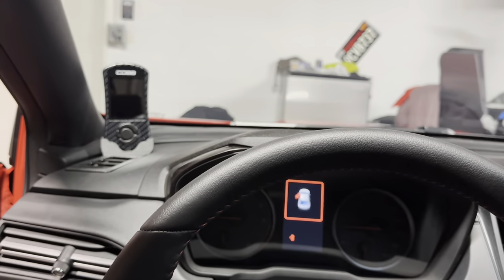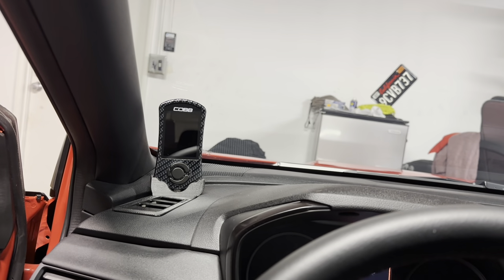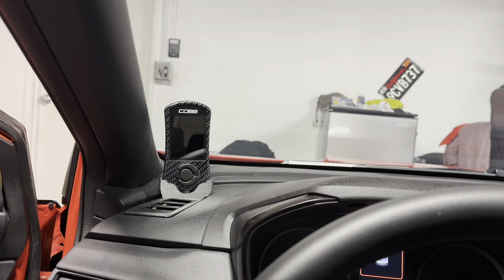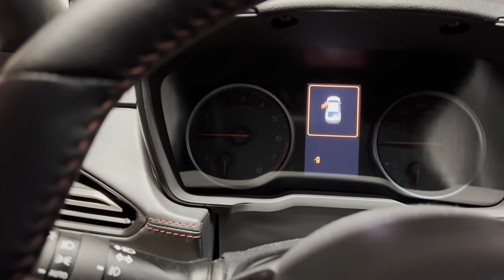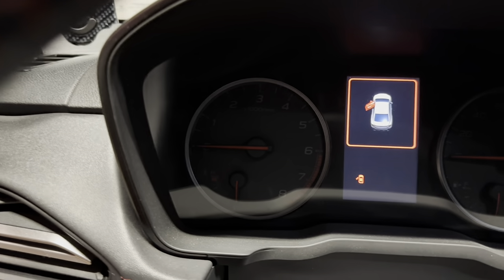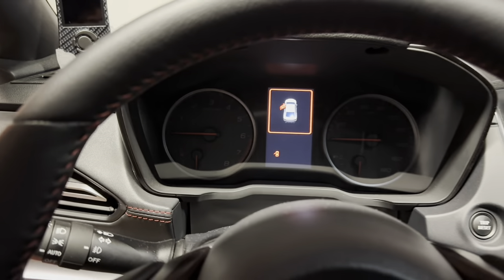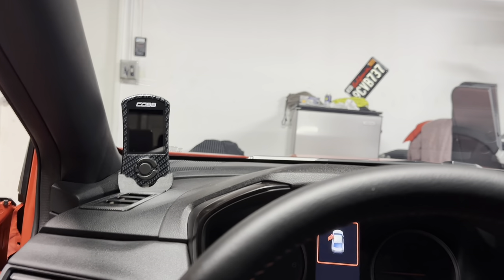If you're running an intake, pay the $150 for the tune — you can get it from Felix Performance or directly from Anthony Barry himself. I contacted him on Instagram and he had it to me the next morning — it was midnight California time and he was still responding. I just needed the serial number for the Cobb, sent it over, he loaded it up. It's been great. I was having a little issue at the beginning on cold starts where the RPMs would flutter — coming down from about 2,000 to 1,500 and dropping below 1,000 to around 700-800, with a little surge. I still get it occasionally but it goes away after driving.